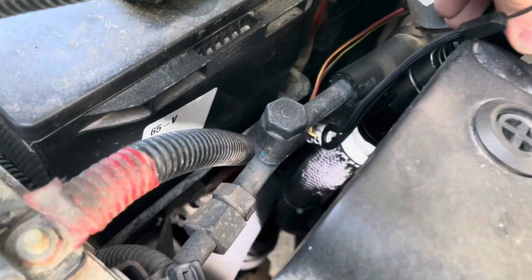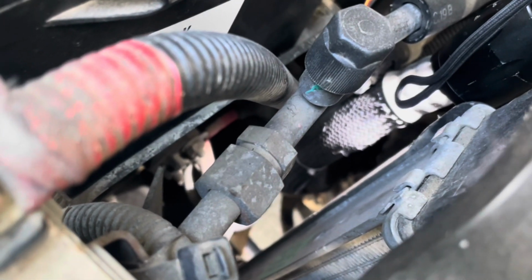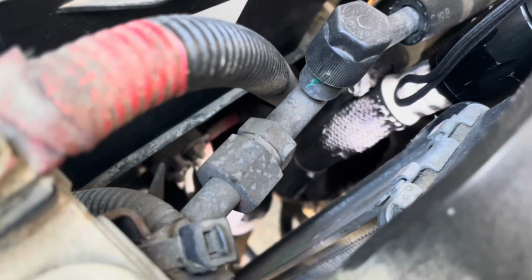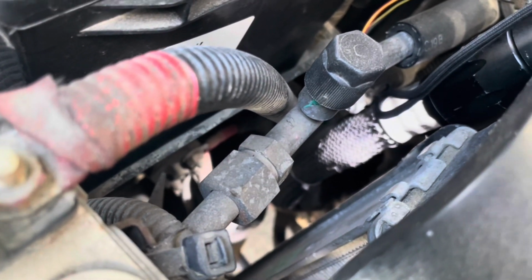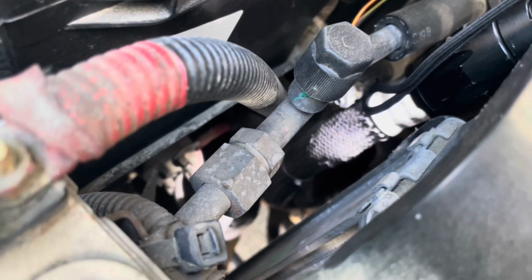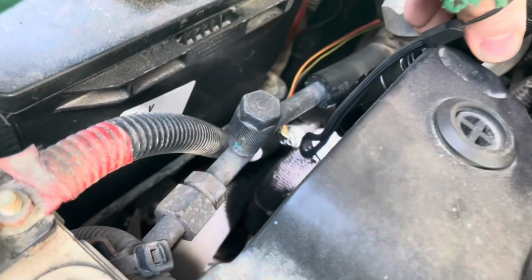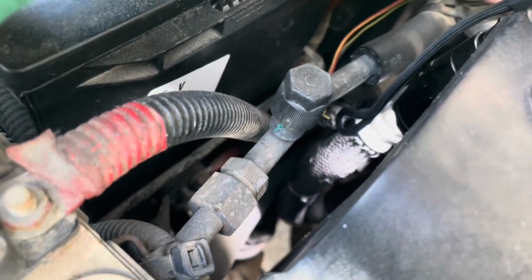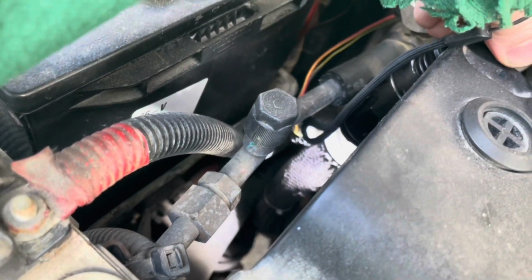Trying to show it with the flashlight. It's the red lead. You see the post. You see a whole solenoid underneath there. Gotta get to that. The connections are definitely looking crummy, and we're gonna have to test it. The voltage readings we're getting in the fuse box are very consistent with a problem with that, with or without a battery.